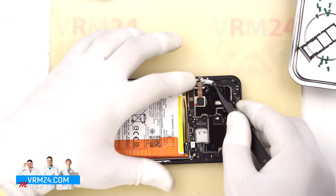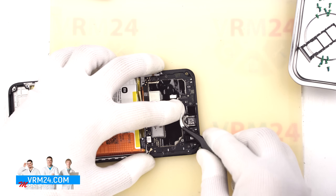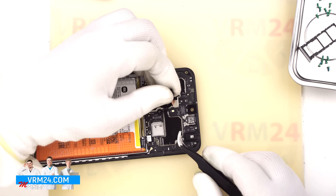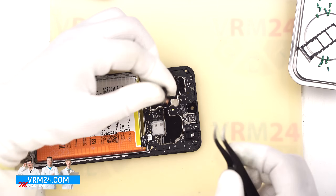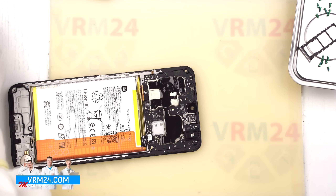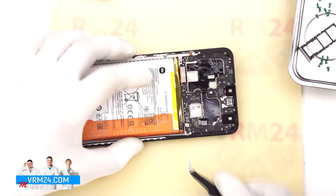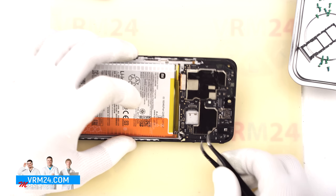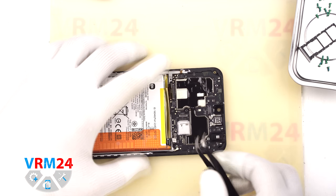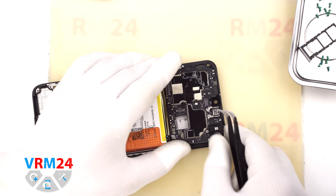Now we move on to the motherboard. We disconnect the rear cameras and set them aside, then disconnect the front camera. The front camera is traditionally attached to the main board shield with a copper heat-dissipating foil — we carefully peel off the copper foil, which will be needed again during reassembly. Next we cover the camera lens to prevent dust from getting on it. Then we disconnect the display flex connector, inter-board flex connector, and coaxial cable connector. We check that nothing is in the way and no screws are left, find the correct spot to gently pry it up, and lift out the motherboard. Please note that the motherboard may also be held on the reverse side with thermal tape.